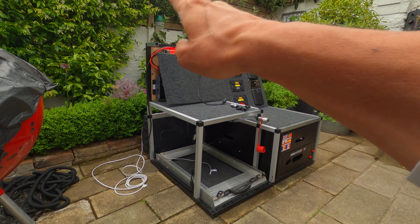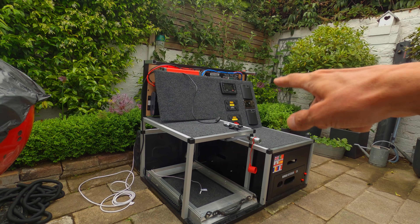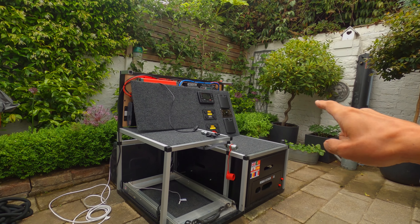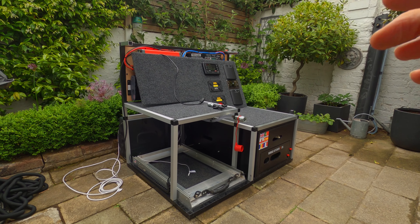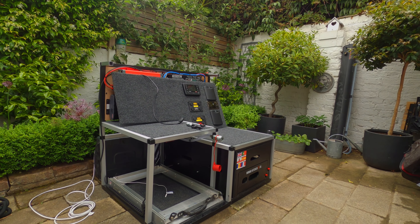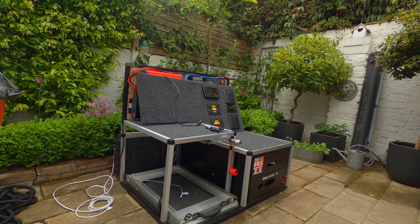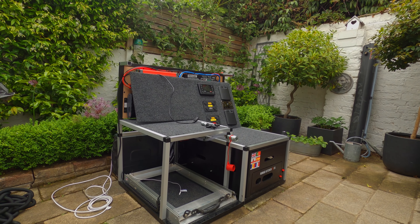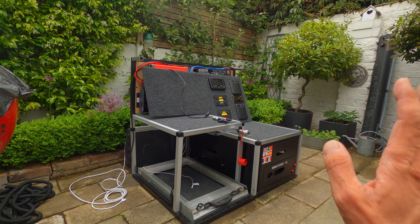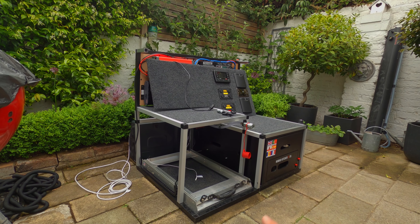This should go in this weekend. I'll put that frame piece in and I've still got some wiring to do — all the 12 volt 10 amp sockets need to be wired up as well. The compressor is in, the fridge is already connected, and the water pump is already connected up. Ideally I need to get my battery out here and test everything. I haven't tested any of the water lines to make sure there are no leaks, so I'll probably pop out the battery, hook it up, and test it all — make sure everything's working before it goes in the vehicle, because the last thing I want is to put this all together and find a problem when it's not easy to work on.